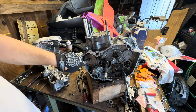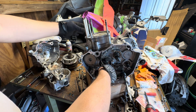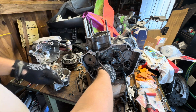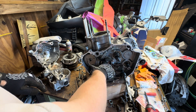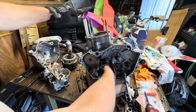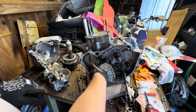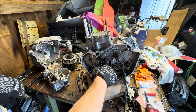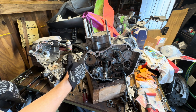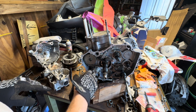You'll notice the camshaft pin is not lined up. The piston is going back down, and now we notice the intake valve is raising — that means we're sucking in the fuel and air. Now as the piston rises, that is the compression stroke. Both valves are closed. We get it up to top dead center and we notice that the pin hole and arrow are all lined up perfectly.